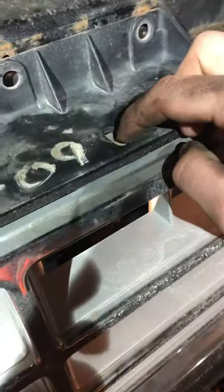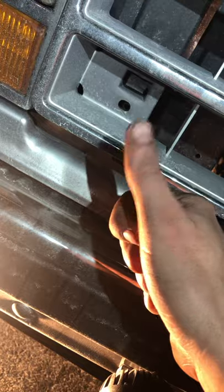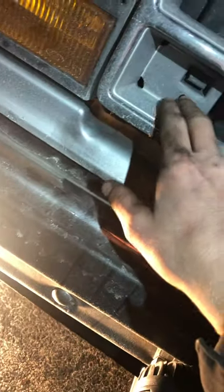Once you get that off — there are a bunch of them, all the way down — I'm going to pull this piece off. That gives you a little better access in there. But I went a little step further and actually pulled the front grille off, which is pretty easy too. There's a trim, basically like a push trim, a Christmas tree style thing to retain the bumper down here and over here. Up here there are these little metal Phillips screws — one up here and one right over here. I'm going to take this one out.